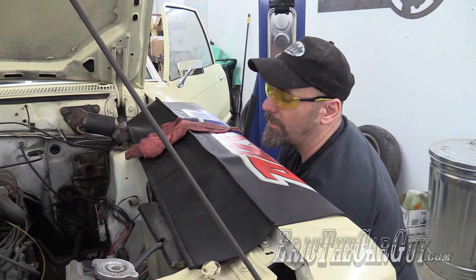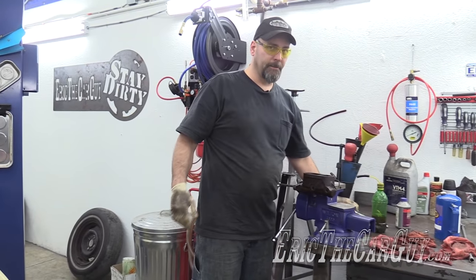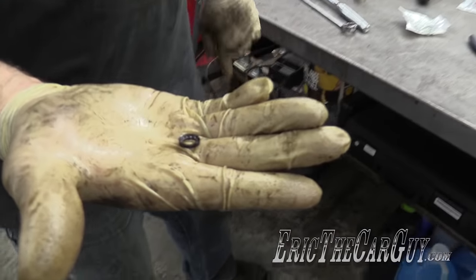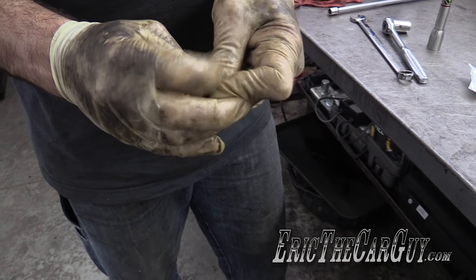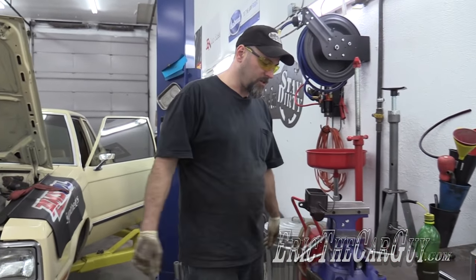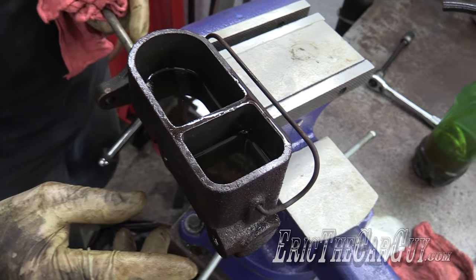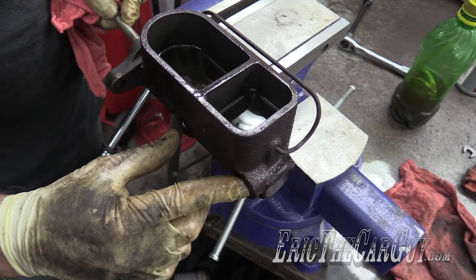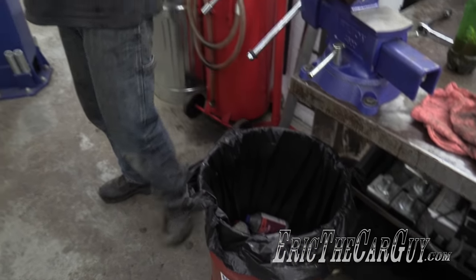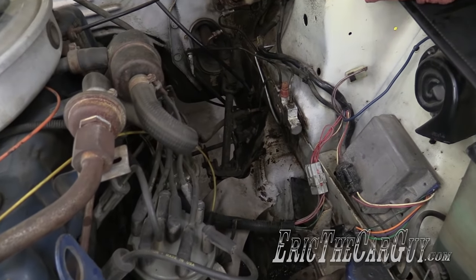So what's going on here - when last we left Eric and Brian, they were trying to bleed brakes. We weren't having a lot of success with that, and it's the second day of not having success. So we gutted the proportioning valve. However, I just removed it and found this little rubber gasket thing, which probably went on the end of this, still wedged up in there. I'm thinking that was causing the problem. I've also removed the master cylinder to make sure it was functioning properly - and it is. I can see it's bench-bled now. This port is the back brakes, this is the front, so large reservoir for the front. So I'm feverishly trying to get the proportioning valve back on and reinstall the master cylinder.